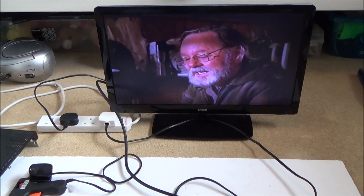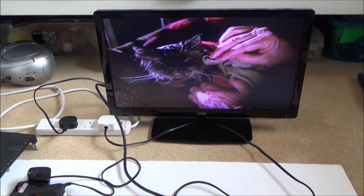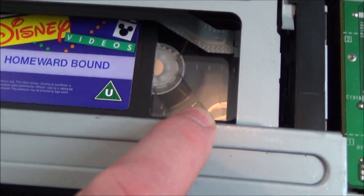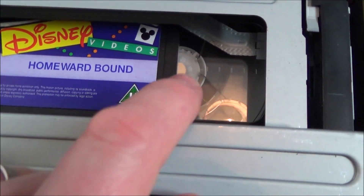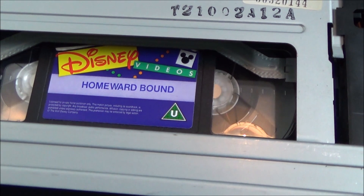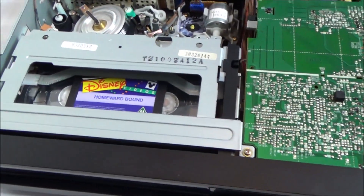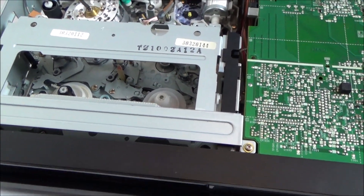I'm trying to provide a little more tension by spreading the spring and roughing up the felt pads to see if I can get it to play at all. Look — it's working! The picture's pretty good considering it's VHS, and the sound sounds good. But it's not working perfectly — this one side is hesitant and then suddenly picks up speed again. You have to be patient! I can press play to pause it, and press eject — you can see it comes out. I can't test fast-forward or rewind as I haven't got the remote.